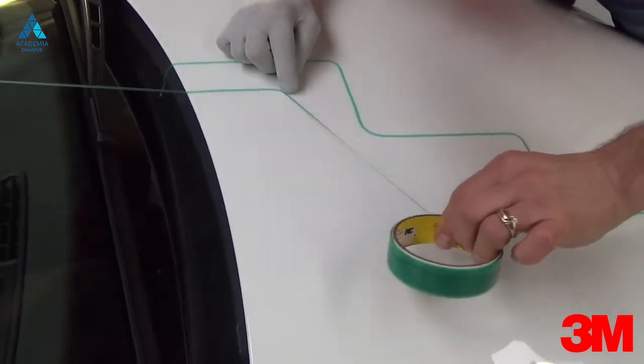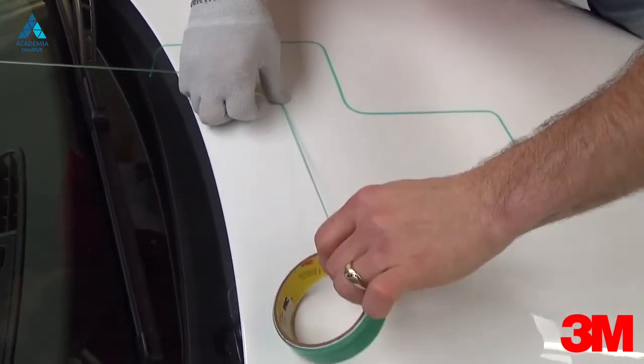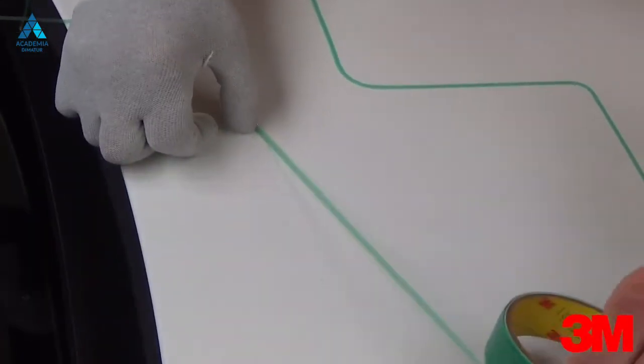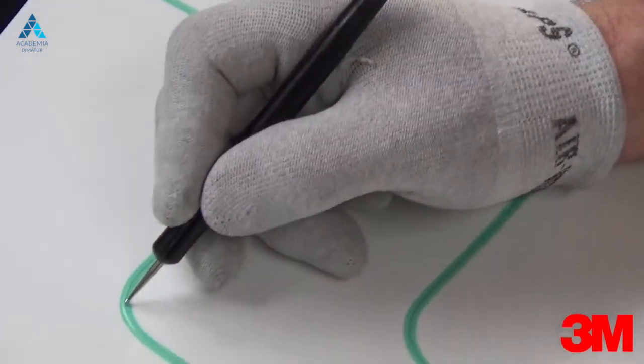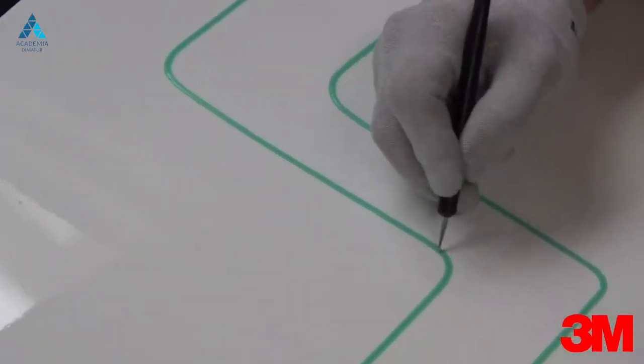And if adding Design Line, in this case for a parallel run, repeat the exact same steps. Angle the roll of the knifeless tape into the corner, only seal the outside edge of the green tape, lightly form it onto the curve with a fingernail, then come back with the burnishing tool to completely seal it to the surface.